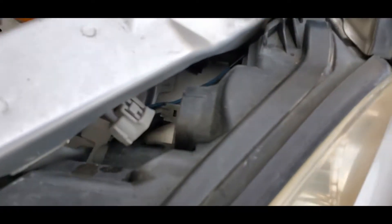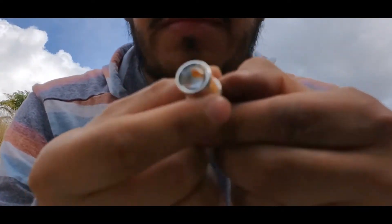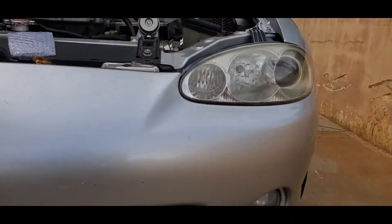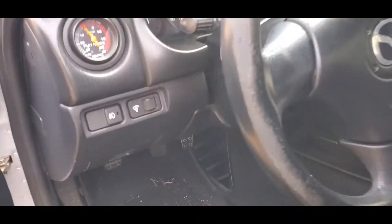For the other side, again just press that little square button, pull it out and twist it. You can see these little flaps — twist it out, remove it, then replace it with the LED bulb. I would assume they're gonna be pretty bright. Put it inside — I'm putting it in this way and it's not going in, so I'll do it the other way then turn it and it's on. If you don't buy this relay, they're gonna start hyper flashing. Now they're on but you don't get that little orange amber glow, so let's turn on the hazards — you'll see it's gonna start hyper flashing.